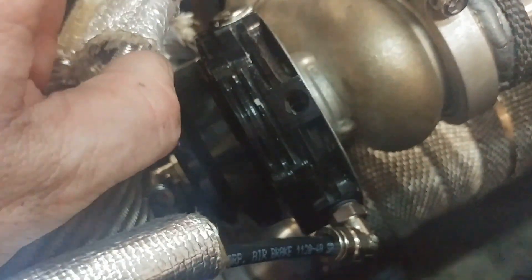The T goes from here to the bottom side of my wastegate, and then from the other side air comes in, splits at the T — some of the air goes into the valve. This one goes to the bottom port, this one goes up here to the top port of the wastegate.